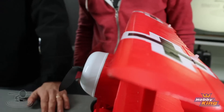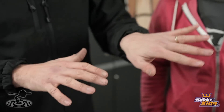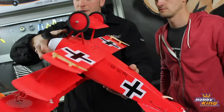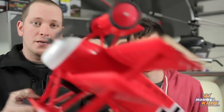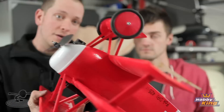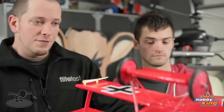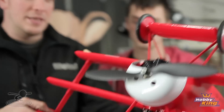The first takeoff it was still inherently tail heavy — it took about four attempts to get it off the ground. When I finally did, I nearly crashed it because the tail was washing out. With a tail heavy airplane, when you give any aileron input, that tail just kicks around — the adverse yaw is terrible. Tip stalling is terrible too. When you stall it, it'll always drop a wing tip. Also, if you're flying inverted and you're constantly pulling back on the stick to keep it from climbing instead of pushing forward slightly, your plane's definitely tail heavy.